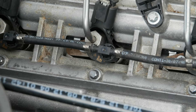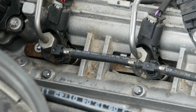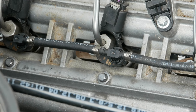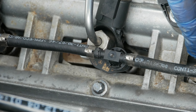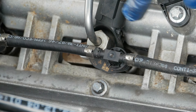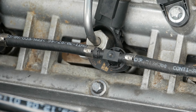If you want to see this process in detail, I actually did a video that shows exactly every nut and bolt you have to undo to get access — I'll link to that in the description below and at the end of this video. The stainless steel pipes and fittings are the high pressure diesel supplies to the fuel injectors, and the black hoses and black plastic fittings are the return lines. We're looking at each of these injectors in those areas for the fuel leak, and as you can see everything looks alright.